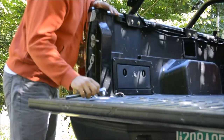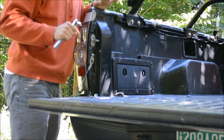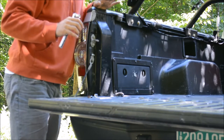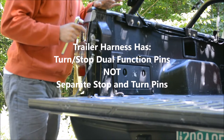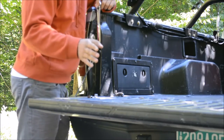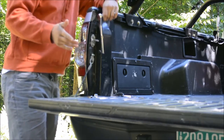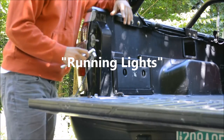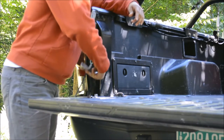Something interesting I found out while tapping into this harness: I got all the wires wired up and found out that the trailer harness actually has two slots but they don't have a specific brake light slot. They have a dual stop light and turn light — so whenever the turn signal is going, it overrides the brake light and makes whatever side flash. That's okay if you're running all red lights, but an amber or orange light can't act as a brake light. So I realized I'll just tap into the brake light directly. I can still use the tail lights from the wiring harness, but I'm going to tap into the brake light wiring because I know that has separate blinker and brake lights.